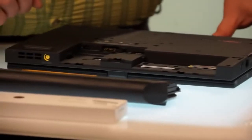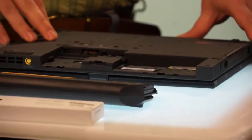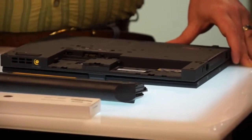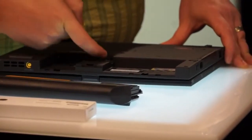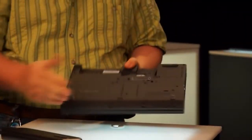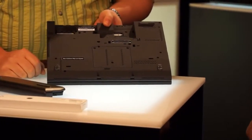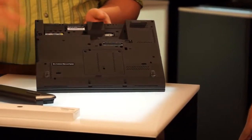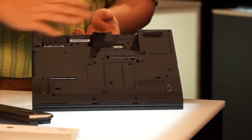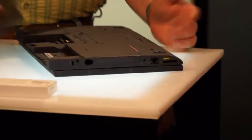If it's of interest to anyone, I will point out that on the models equipped with wireless WAN, where you've got your cellular data card built in, we'll have both 3G and 4G versions available for this series. The SIM card, for those of you on standards that use SIM cards, GSM, this is where the SIM card would go, right in here. Beneath the battery. And one small change we've made, mostly for cosmetic reasons, this generation. Now, this is pre-production, so yours will not have a customer ship level system. If it does have that, give us a call. Yes, this is obviously proof positive that this is truly fresh from the factory. We've moved the stickers underneath the battery just to create a more uniform, clean visual experience. You can still certainly get to your labels to look up various things if you need them.